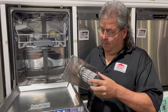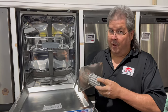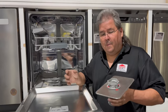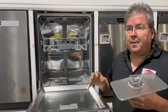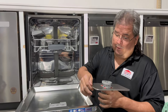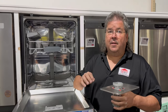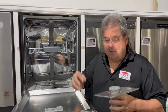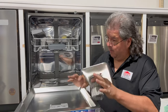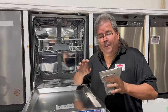If these are clogged or blocked, it could be due to hard water. If you don't know whether you have hard water, you probably don't — you'd know. Hard water causes the filter to crystallize up and you get that white film over everything. You've got to clean those up. You can use a brush, a toothbrush — if you're mad at your husband you can use his toothbrush, but I didn't say to do that. You want to check for that.